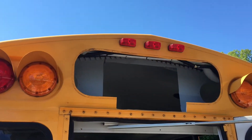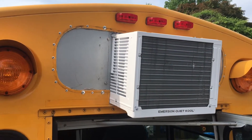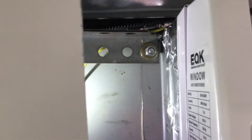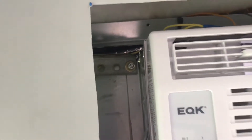We got easy AC access through the rear sign light. The rooftop ACs are expensive — this was $150 delivered to my house on Amazon. The steel came from an industrial cabinet that was getting chucked in the garbage. I cut out little angle brackets, mounted to the chassis of the AC from the inside with rivets and bolts, and then the whole thing slips in from the inside of the bus. I reinforced it with some channel steel bolted to the frame, so it's in there solid and all sealed up. Meets one of my requirements for New York State for AC or heat.